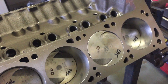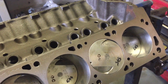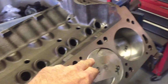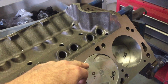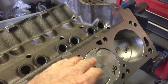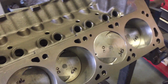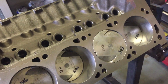But these days lots of manufacturers make gaskets that are approximately 40 thou thick, and that's the perfect amount. Give or take a couple of thousandths of an inch in this particular realm of the combustion process is neither here nor there. So we're going to run a regular off-the-shelf Felpro type gasket, which is going to compress to approximately 45 to 50 thousandths of an inch.